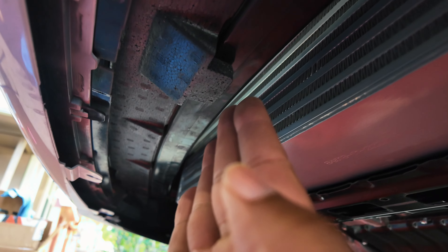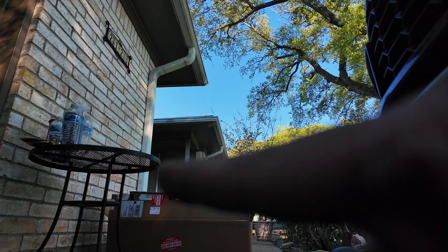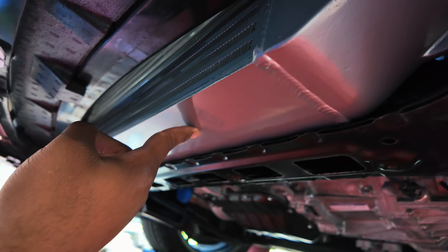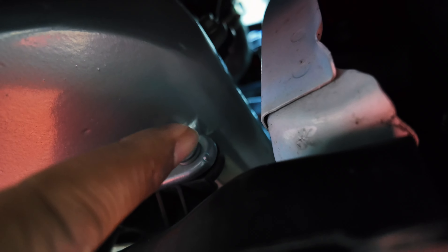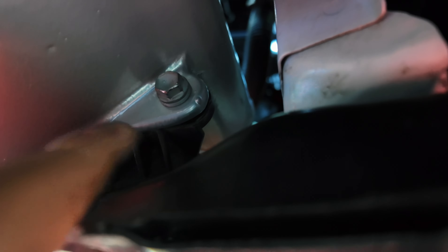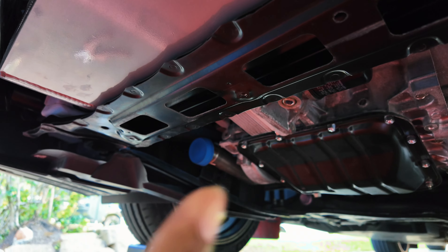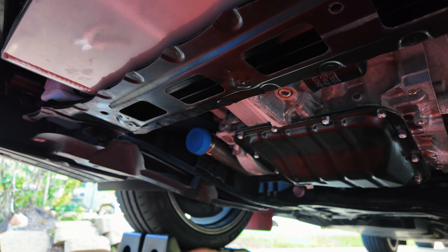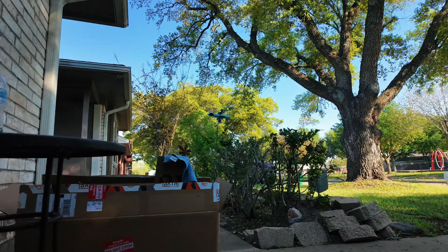See it all the way down there — nice thick front mount, you can see the little Six Element sign right there. If you wanted to put the full stencil on, it's somewhere in the box. Intercooler's on; we still have to get the piping on. The silicone hose at the very top is going to go into the cold side, and then down there — you see that little blue cap — that's the hot side where the other silicone hose goes back to the turbo. Easy peasy.